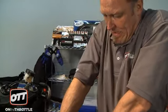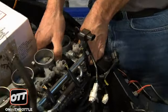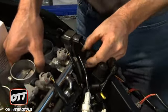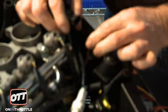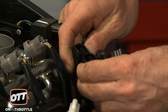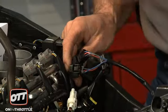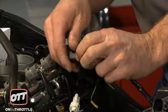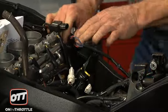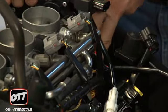This particular switch is extremely difficult to get to. Very, very carefully you need to grab the fastener and be very patient and manipulate that out. We don't have much cable here so we're going to have to be careful. The Bazzaz component that clips into the OEM piece must be identical — in this case, they are. Go ahead and clip that into the original piece and it'll snap every time. Then take the other end from the Bazzaz electronic harness, manipulate the harness a little bit to give you some free room, and then go ahead and install this where the OEM clip went.